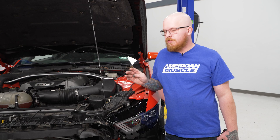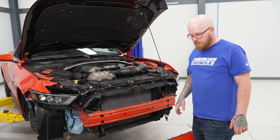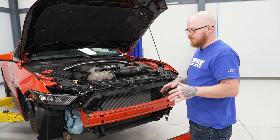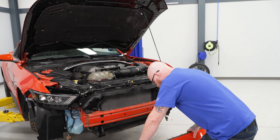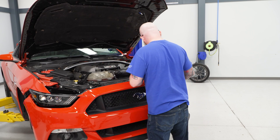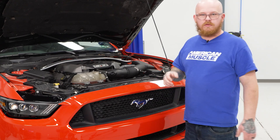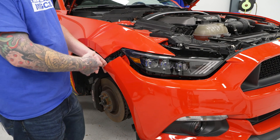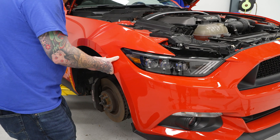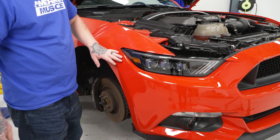Once you've got one light back on, go ahead and do the same thing for your other headlight, then start throwing the bumper back on. We'll start at the front top section — there are locator dowels. Get the front top of the bumper in place on the dowels and that'll hold everything in place as we get the rest of it on and secured. Then grab the edge of the bumper that lines up with the fender — yours from the factory will have the screw going through to attach the bumper to the fender. Get it back into its slots and make sure it's nice and flush, then do the same on the other side.